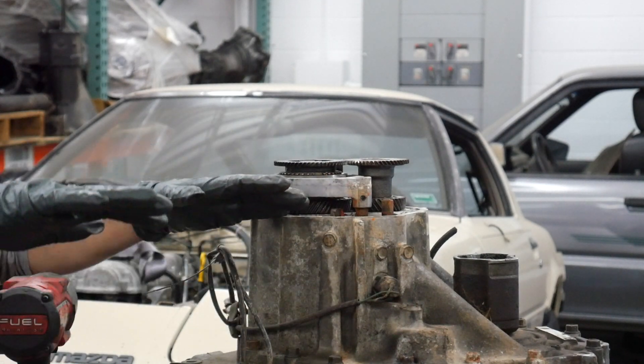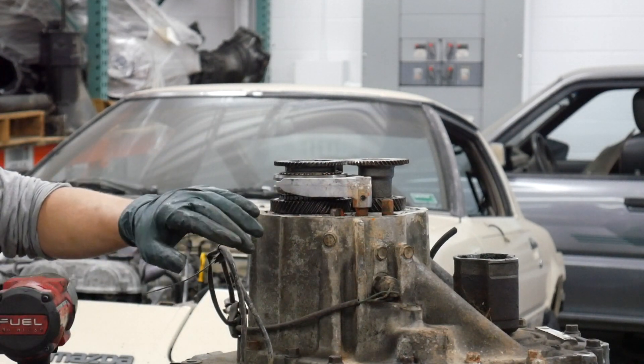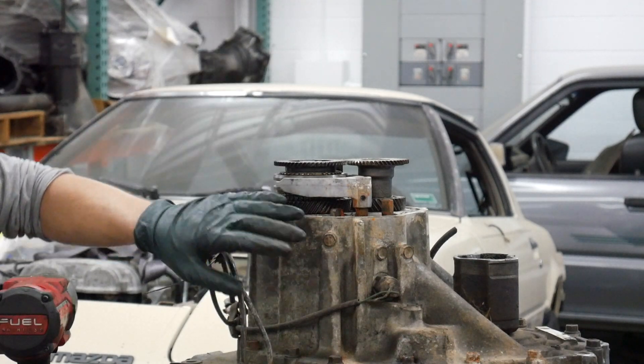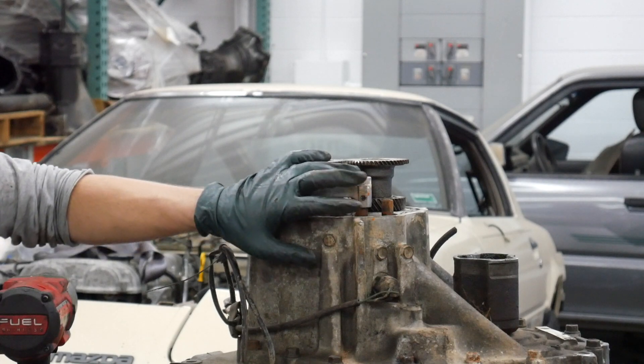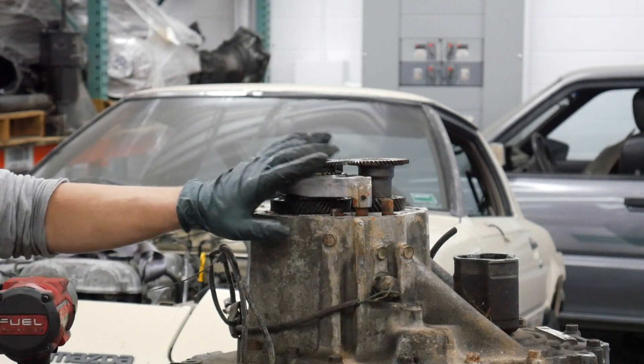If you make it a little angled toward the passenger side, the transmission fluid will run away from this side of the transmission, which will keep you from having to add transmission fluid and keep it from hitting the ground when you do this.